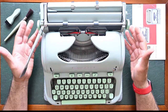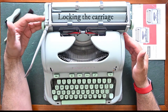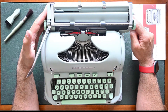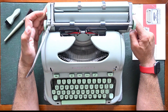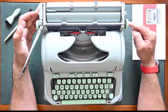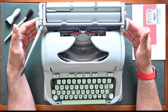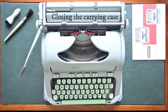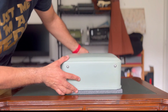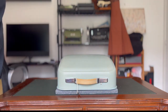Now that we've covered all the options we need to lock the carriage to fit it back into its case. I always recommend moving the carriage slightly to the right side. Hold it from the left side and use the lever on the right side under the right knob, press it down, then using the carriage release button on the left side move it while pressing on the lever on the right side to the center and then release the lever. Now it's locked. To fit the lid back on the typewriter, get the lid and make sure on the back it's all centered and well fitted. Then using the lever on the front you move it to the right and push it a little bit down — and now it's locked.